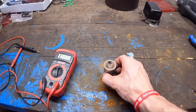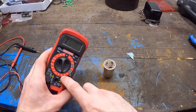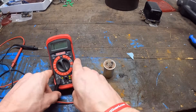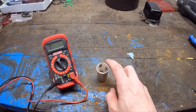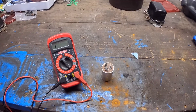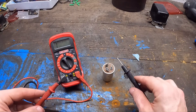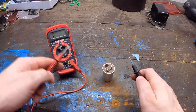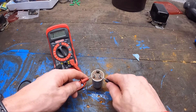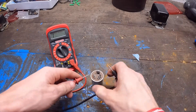The first thing we're going to test is our indicator relay here. We're going to get our multimeter and set it on the continuity setting — it looks like a little Wi-Fi signal. The theory is we'll test the three terminals on here, and there should be no continuity between any of these connections. We should not have any positive reading or any beep coming from our multimeter. So we're just going to go between all the terminals and check that we don't have any continuity.